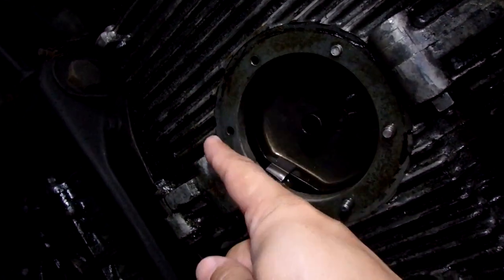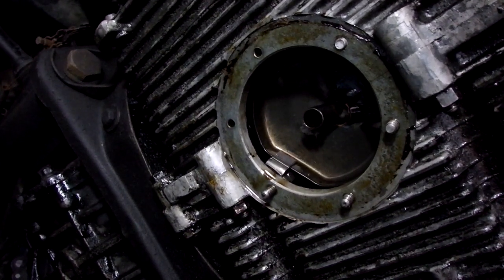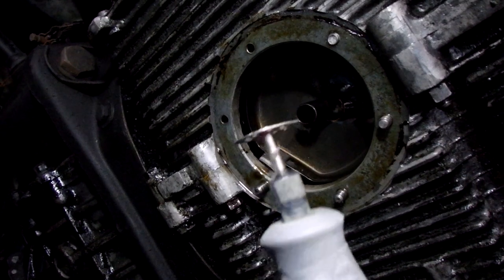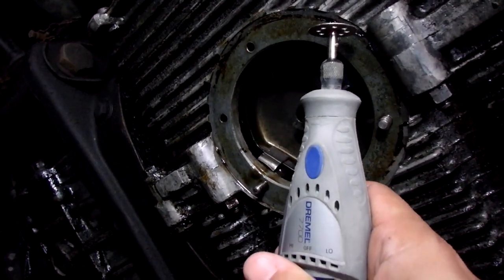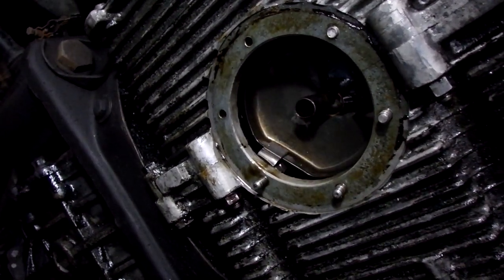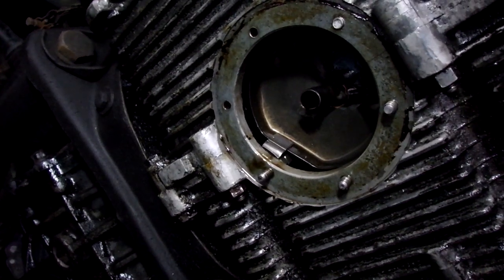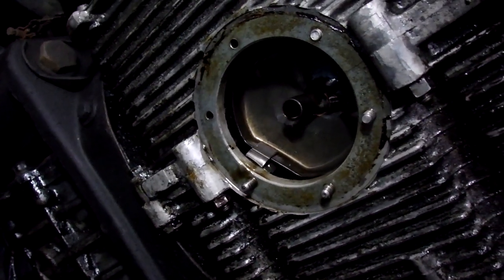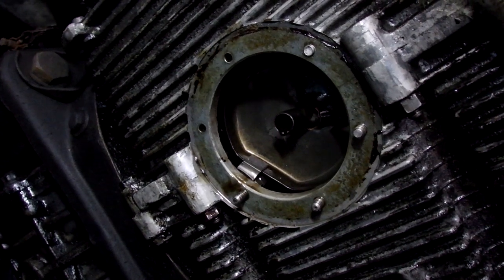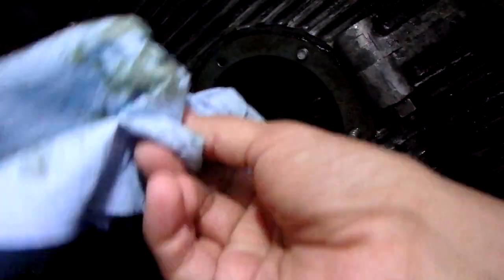You see these other two — the studs actually came out with the bolt, which is okay, not the end of the world. Right now we're gonna get this stud out. The way we're gonna do that is take our handy little Dremel and put a nice little slit right in the middle of that stud, so we can grab our flat head and just twist it right back out. I want to be very careful — I only have one chance at it, so we've got to be careful not to go too deep or break the stud. It is magnesium, I believe.